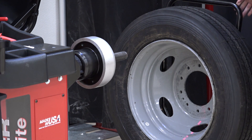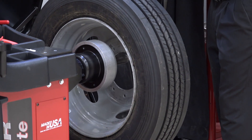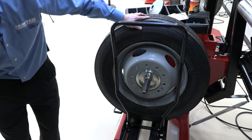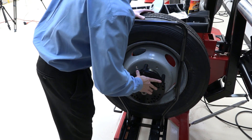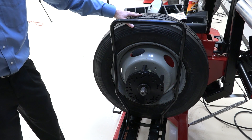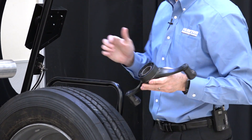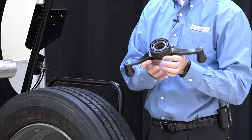Now I'm going to use my wheel lift because I'm on the heavy-duty elite balancer and this wheel is very heavy. I'll bring this up and slide the wheel over the disc. Once I have the wheel over the disc, I grab my flange plate — I've preset that to the 10 by 225 millimeter pattern — and slide it up until the fingers engage the lug holes. Then I grab my wing nut. The wing nut has this spacer installed on it, which is critical because we don't want the metal of the wing nut contacting the metal on the flange plate, as that can help it unwind once the balancer starts spinning.